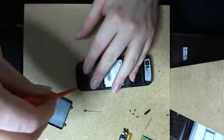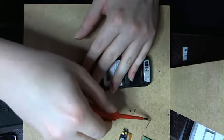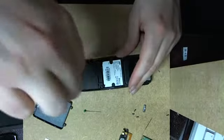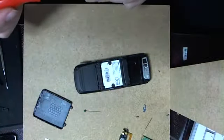One day I will cover the G600. That is terrible. It's a nice phone, huh? But there it was. Okay, I put another one. The G600 is terrible because if you get that with the flex broken, it's going to take you an hour. Because as you see on this, the flex is like you can take it off. On the other one, they not only put a long flex, but they also bolted it on the metal of the slide. So you have it glued and bolted. It's a long work.